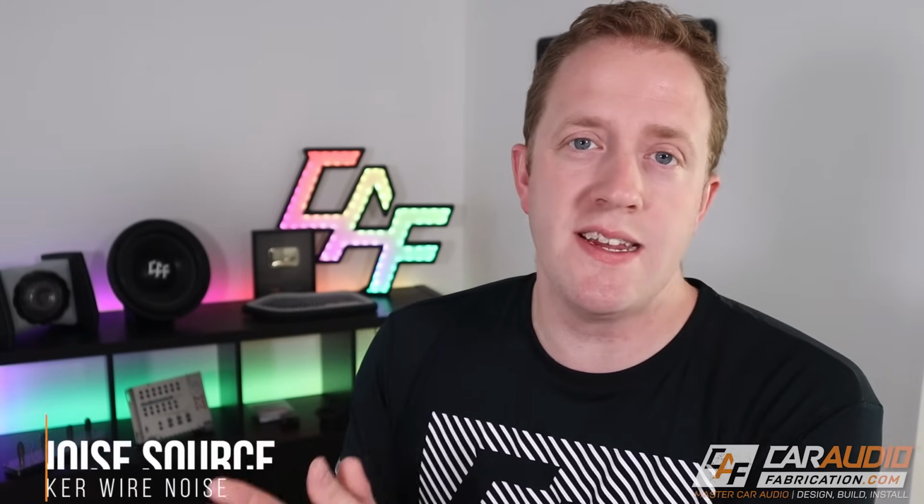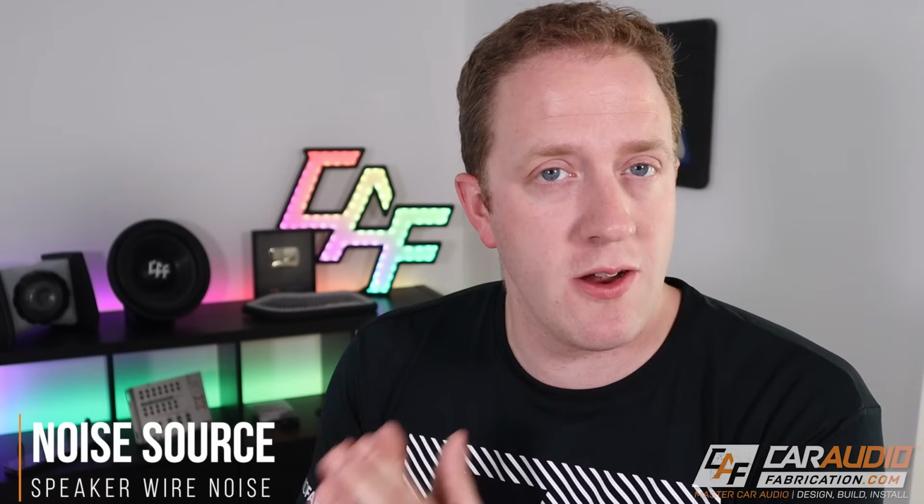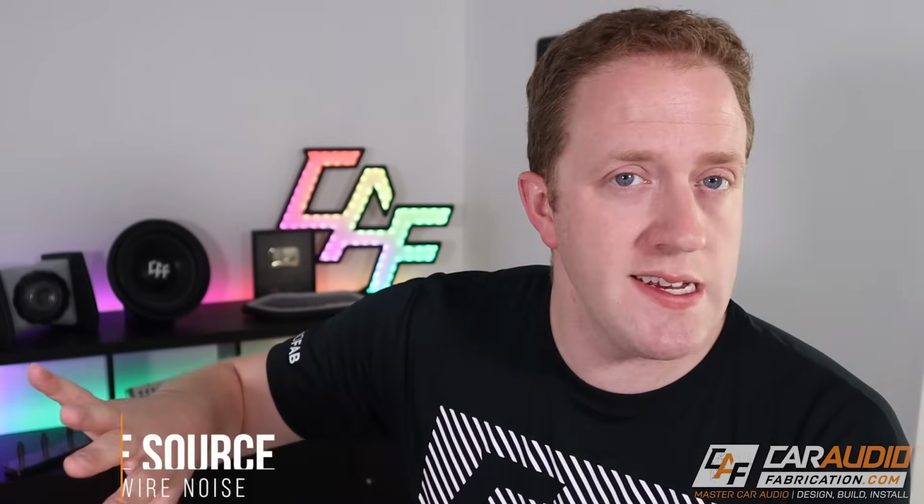Moving on here, another noise that is possible is noise that is radiated into the speaker wire itself. So if you've tested everything that we've talked about so far and you're still having issues, something you can do is disconnect the speaker wires from your amplifier and see if you're still getting some sort of noise. This isn't really a common issue that we see, but it can happen where an electronic component is really close to a speaker wire and it's creating some sort of noise all on its own.